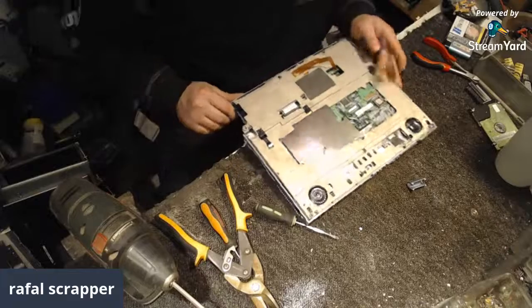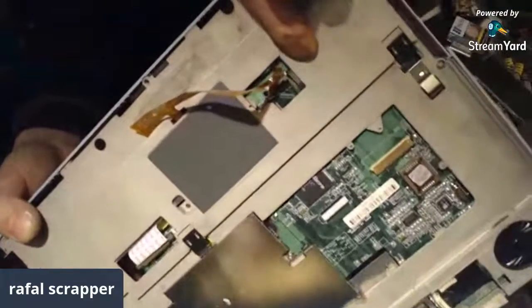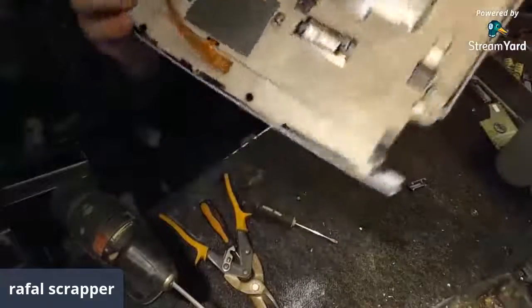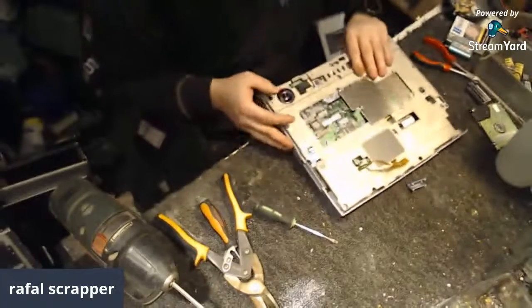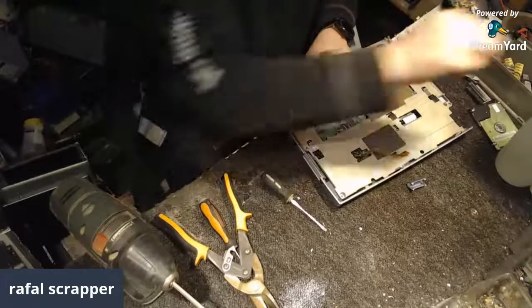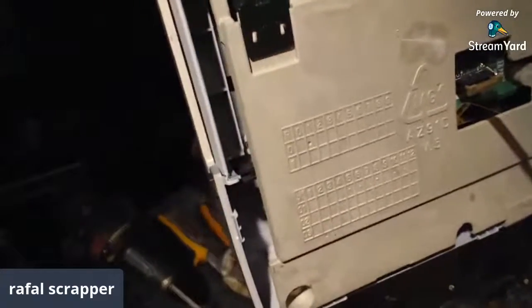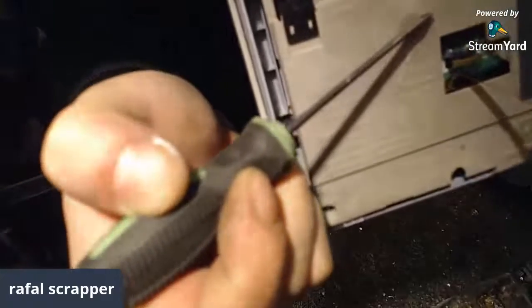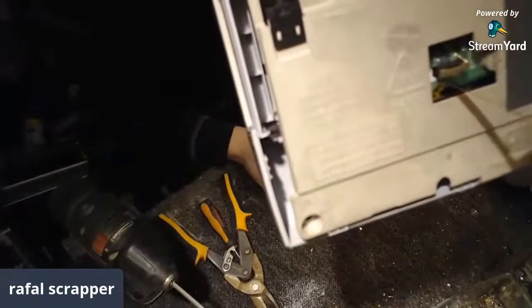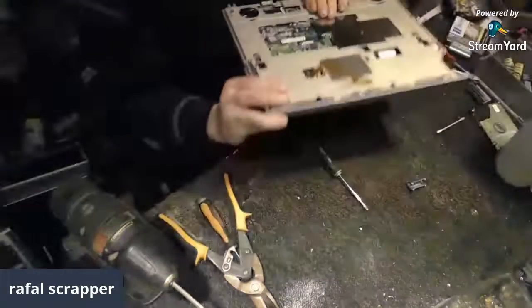There's basically not so much in it. And this, for sure, is magnesium because I got one tiny mark just right there on top of my finger. It says MG, as you can see right here. And to prove it is MG, I will scratch it just like so and add some vinegar on it. And you can clearly see tiny fizzing right away. If I give another scratch... come on, focus on it. Anyway, I hope you see it.